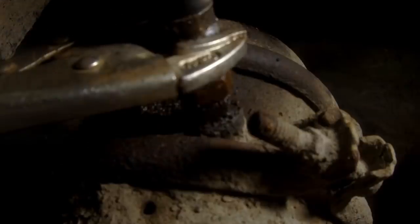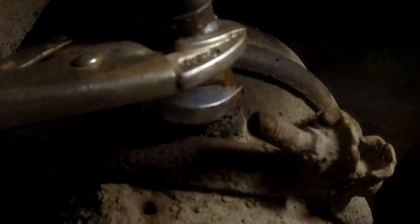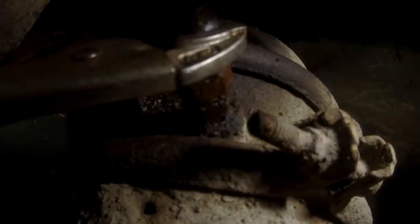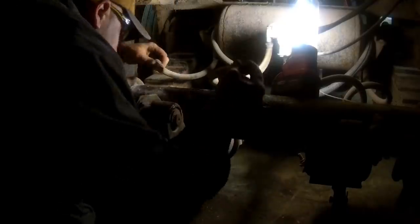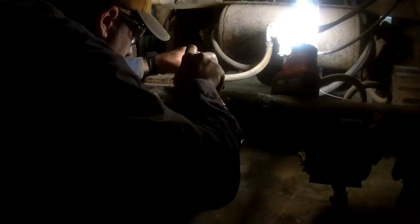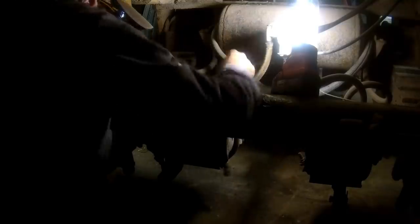We're gonna get this off, and then we'll end up pulling the whole brake chamber off. So we know this hose is coming from the left, and the other hose is coming from the right. So we want to make sure we don't screw up the location of them here. Alright, we've got our hoses unhooked, both of them here. Left side, right side. Actually spray these, see if maybe some of that penetrating oil can't get into them swivels. We're doing the rest of this work to this chamber here. Hang them out of the way.